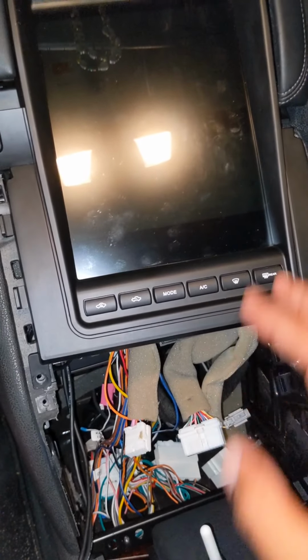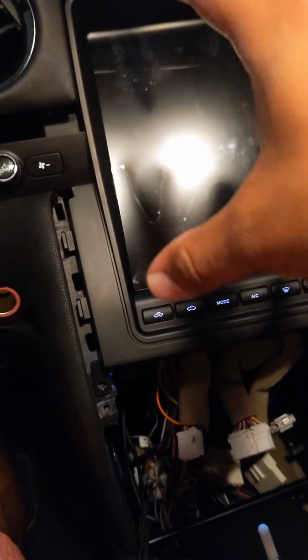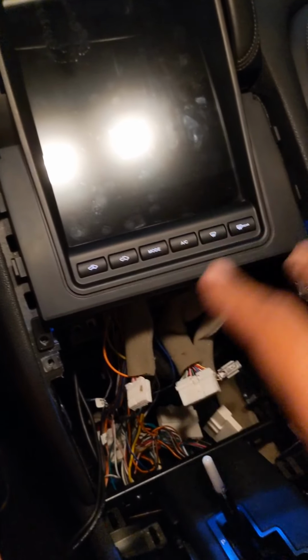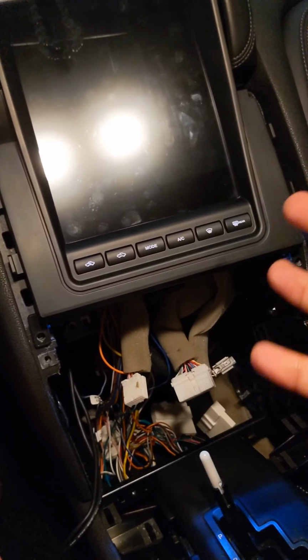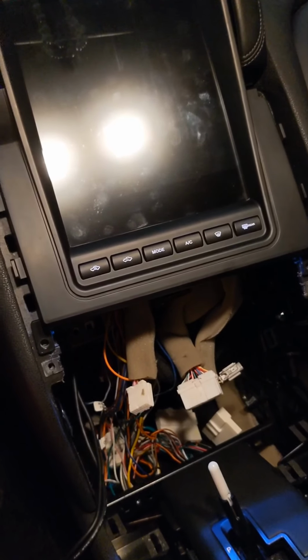So you've got your R switches taken out and the climate control panel taken out. By that time, with this trim removed, you should be able to see the two screws on top and the two screws on the bottom that hold the multifunction display in place. Take those four screws out, and keep your screws handy, because I'm assuming you want to keep the OEM parts if you ever want to restore it. But if you're selling the display or the control panel, then forego the screws, or just include the screws with those units, because the next owner might need those.